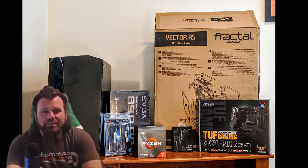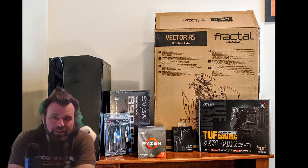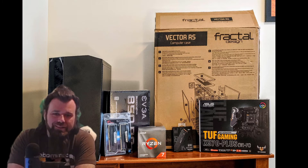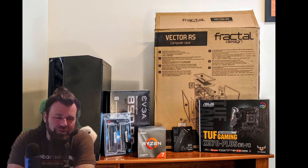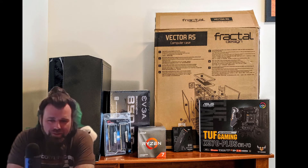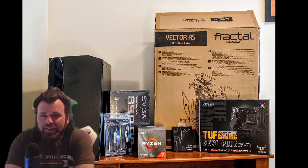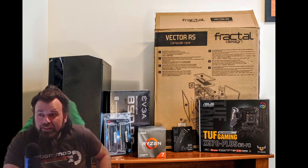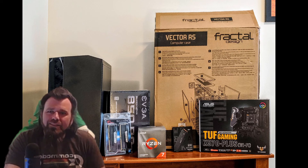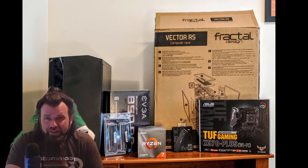It turns out relatively little. If you're getting a new Black drive, Gold drive, or Red drive, there's a pretty solid chance that it's going to be clicking every five seconds and probably annoying you for every second you're next to your computer. You might say, well, I'll just get an external hard drive, and I'll shuck that, and put that in my system. Well, that's too bad, because those are probably Red drives too, and they'll make the clicking sound. Luckily, the Blue drives they have left untouched.